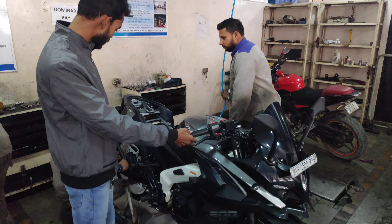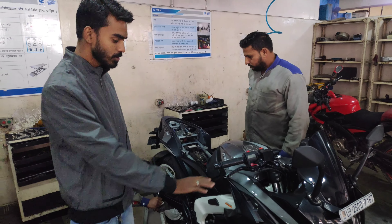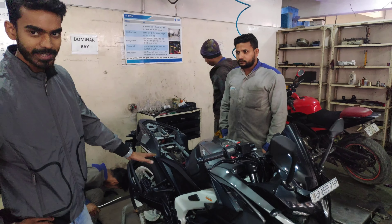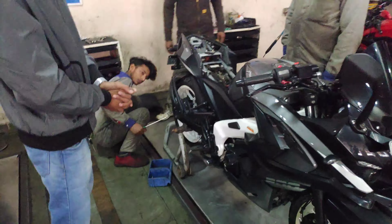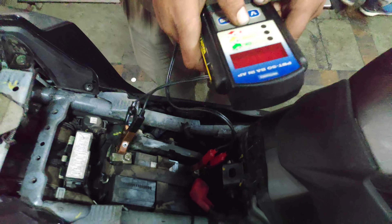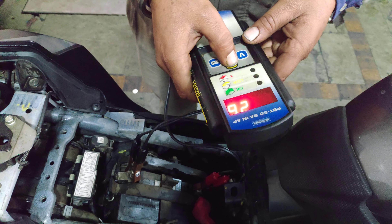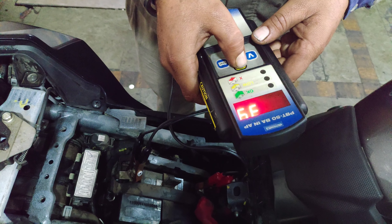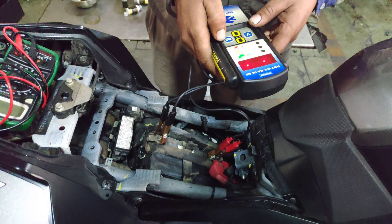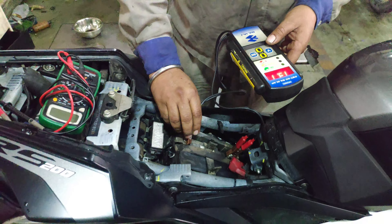We have a normal permit; the software update is coming from the GSX. We need to update the ECU version, we need to update the whole thing. Now we have the battery testing — ECU flash requires battery testing first. So there are two multimeters; we check both of them. We first check the voltage on both — the battery is right and the charger is right — after that we start the procedure.